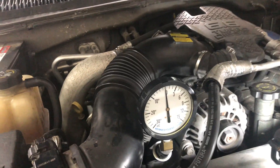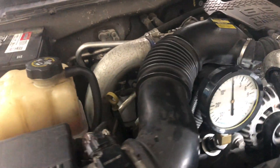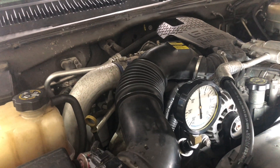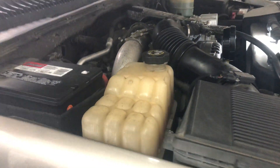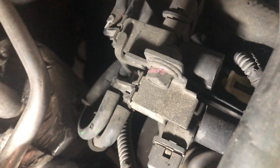I don't usually hook up a pressure gauge, but I'm going to use this as an example. You can do this anytime you're replacing a fuel filter, or let's say you ran the truck out of gas — you're going to have to prime this system. So here's the trick: if you look down inside here there is a bleed screw, and a lot of people use that, but what I'm just going to use is the primer.